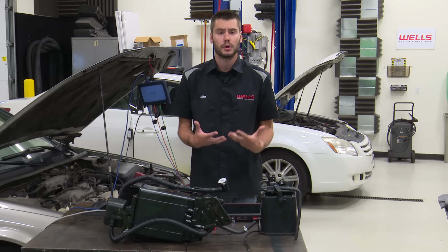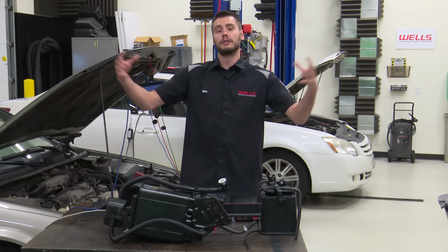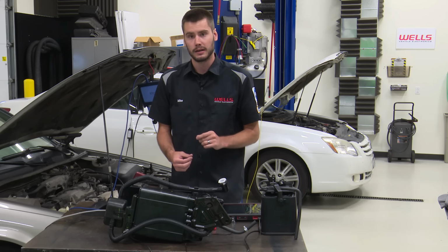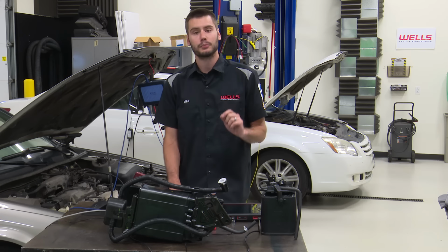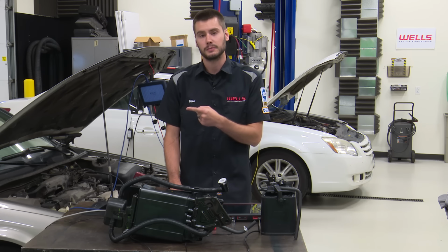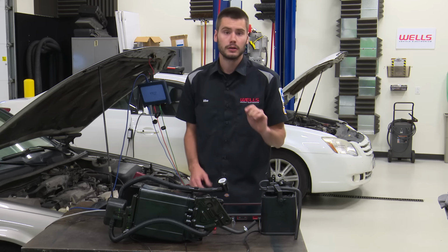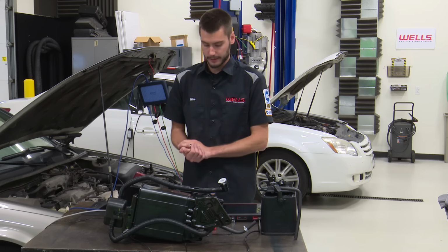With a standard purge seal system, you go ahead and run the purge solenoid on, you close the vent, you draw the entire system down into vacuum. You cannot do that with this early design system. You can only draw the canister down to vacuum, okay? You will not draw vacuum on the fuel tank. But if you apply pressure to that purge port, you will send pressure through the entire system because you will be bypassing or forcing open one of those blow-off valves or pressure relief valves. So vacuum, you're only checking the canister. Pressure, you are checking the entire system, okay?